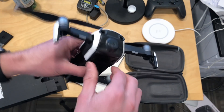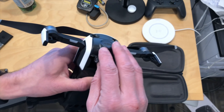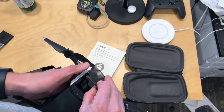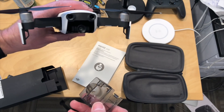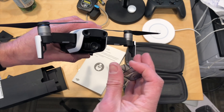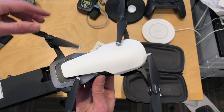The other thing is the front cover on the camera. What you do is undo this part here and then slide it out. I'm a little nervous about this part because sometimes it takes a little bit of force — just get a good grip and gently nudge it forward to expose the 4K camera and the gimbal. It feels very delicate, so when you're transporting it you definitely want to put this cover back on, which you do by sliding it in and snapping it down.